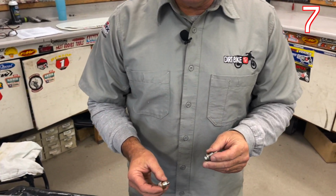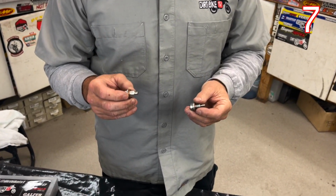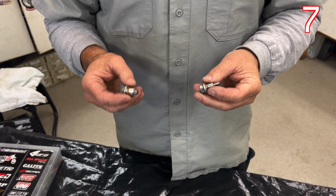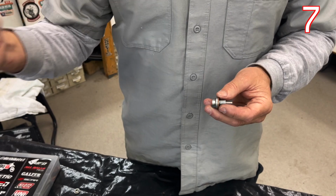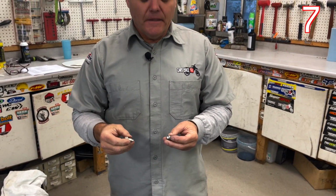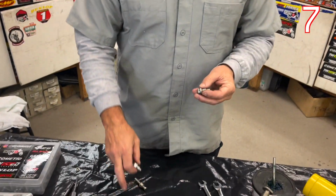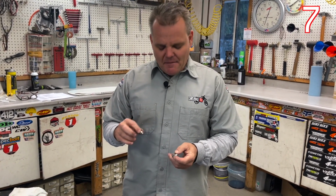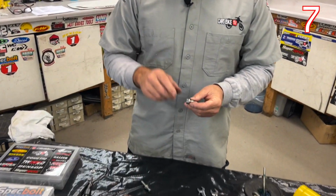Drain bolts are the most common thing that we hear is damaged that causes a lot of problems for guys, because a drain bolt, especially on a 4-stroke, can be very difficult to repair. Sometimes the engine has to be removed. It's going out the back of the engine, so the engine has to be removed to actually work on it. And then to install a Timesert, you can do it without splitting the engine, but you need somebody qualified who's pretty good at it, because you have some grease in there. I've shot videos on that before, so you'll want to watch for that.